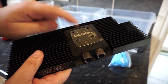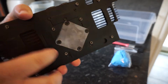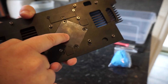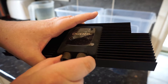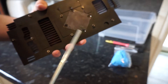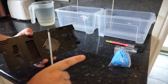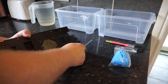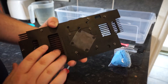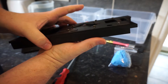So starting off we need to take this off. Turning the block on its back you can see multiple screws which hold the unit in. Do not make the mistake of unscrewing these ones here because that will take the contact plate off the unit itself - this won't actually come out. What you need to do is take a small Phillips screwdriver and start to work on these smaller screws. Be extra careful not to lose these screws - put them in a little pot.